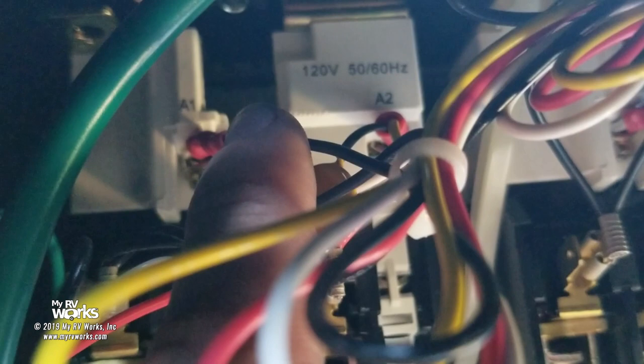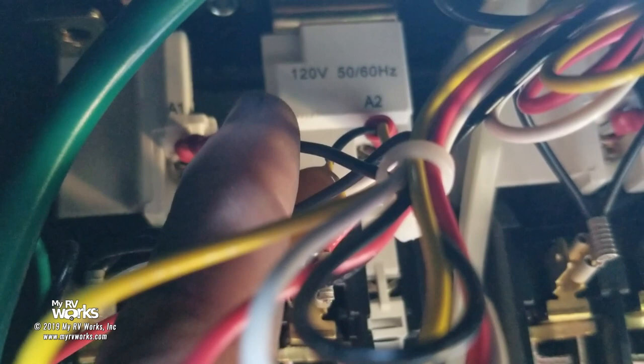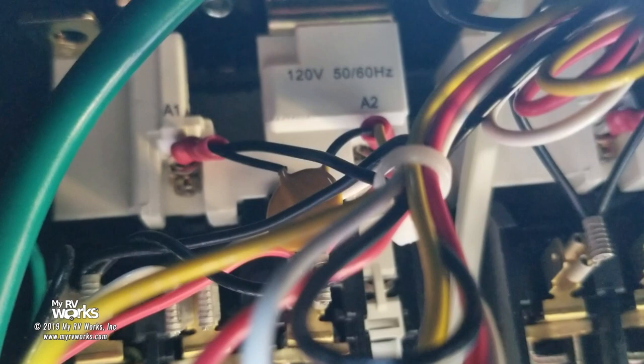You might find something where it's 12 volts DC on your control side that's sealing in 120 volts through a relay. So this would be a relay. The reason it's called a contactor is because it's bigger. So you have a relay, a contactor, a solenoid. They all kind of operate on the same principle. They all have a coil voltage. So now we need to get 120 volts. Now, I'm having a thought.